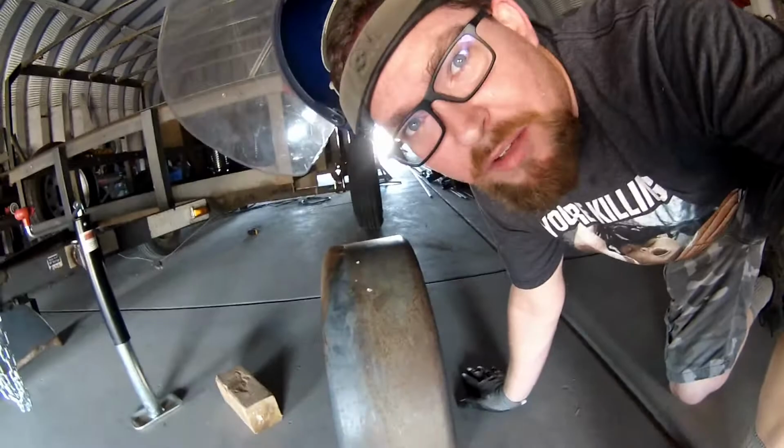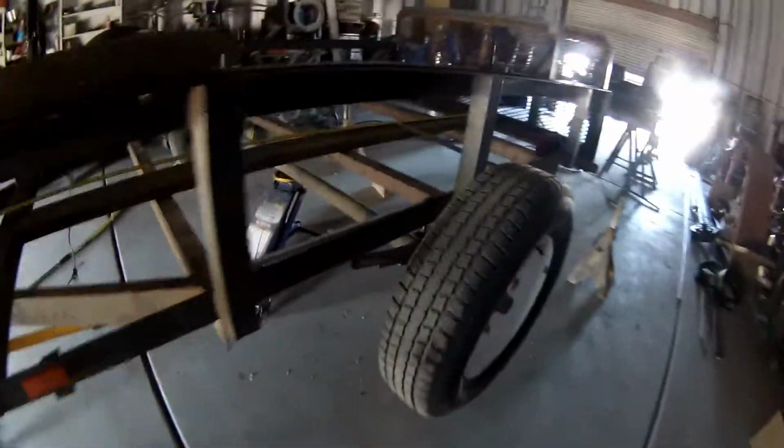Made quick work of those fenders. I'm gonna just kind of play around and experiment with this. I've already got the axle cut free from the trailer. I got the fenders removed, same on both sides. And all I'm gonna do here is just measure the tongue weight just as a test. All I'm gonna do is lift the tongue and put the tongue back on top of the scale and see what my tongue weight is. I've moved the axle from 101.5 to 84-ish.